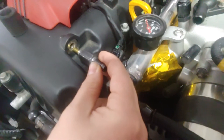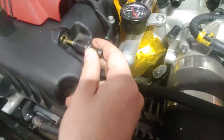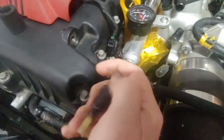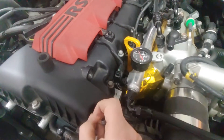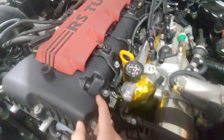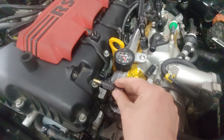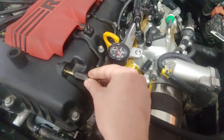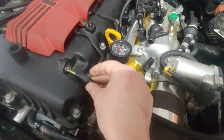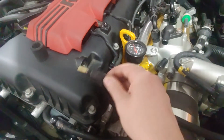On the VK1 there is a metal piece that is pressed into the valve cover and you can't get in there and remove it. I've had my valve cover off and all the baffling in there is ultrasonically welded. What that means is that unless you want to do some serious cutting, you can't actually access this area to remove it, and drilling it out to a different thread size would be more than I want to get into for this.